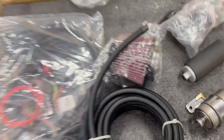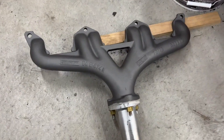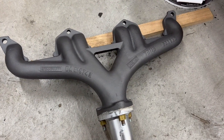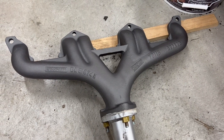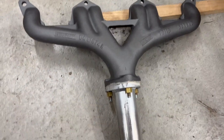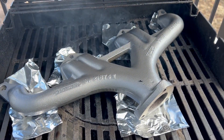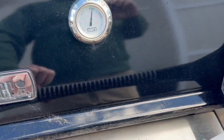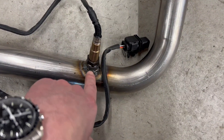Here's your fuel filter slash regulator, which I believe is a GM unit from what I can gather. I pulled the exhaust manifold off, went ahead and painted it with some POR-15, and then baked it in my barbecue to heat-seal it. I've got the oxygen sensor already taken care of — I had a shop weld that bung on there for me.